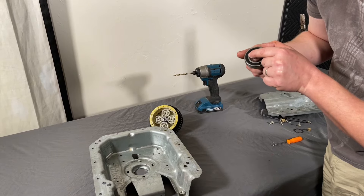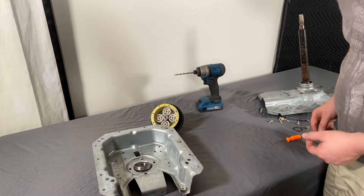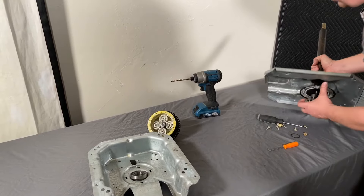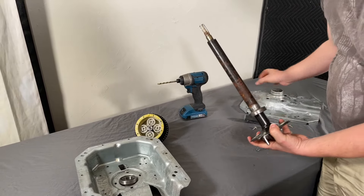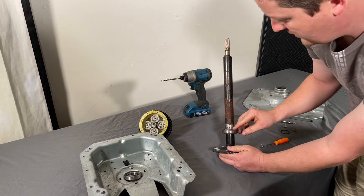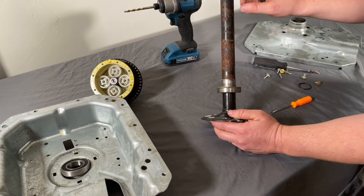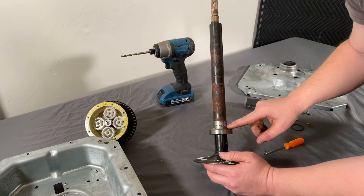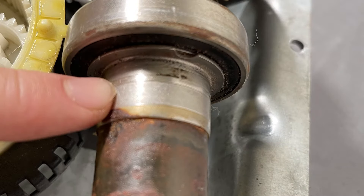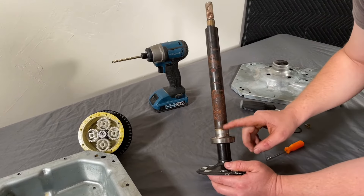Alright, so there's one bearing. Now here comes the problem — here's where I say you may not be able to do this. Get this bearing out after you remove that piece — this top bearing is the problem. Every transmission I've ever taken apart will always have rust here. This is where water is going up and down constantly. I don't think it's just rusted in place — I tried for a while to loosen this up and it did not loosen up. I could not get it off. It may be glued, it may be welded in place.